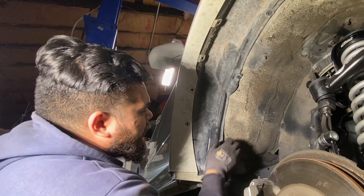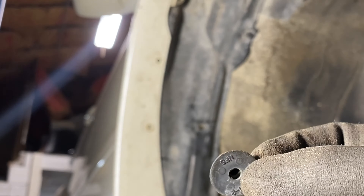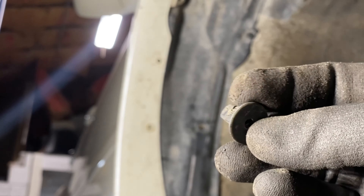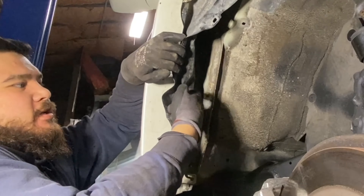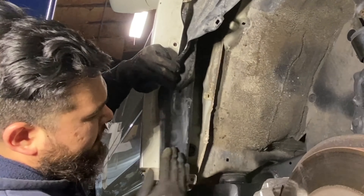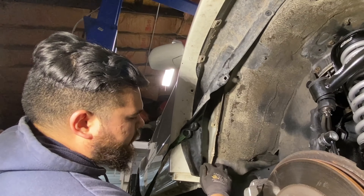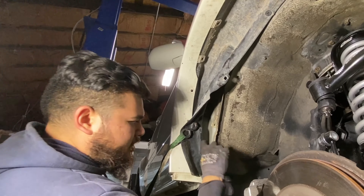Next we've got to remove these little rivets, which can be kind of a pain. If you look into the circle you'll see there's a tab on one corner and another tab diagonally to it — just push those tabs in with a skinny flathead or a pick and pry it out. Once you get a few of those removed, you can pry this back. Grab a bungee cord or ratchet strap to hold it back. This is pretty much all the clearance we need to get to this seam. Now I'm going to grab my angle grinder and make slits every two to three inches so it's easier to hammer in smaller sections of metal.